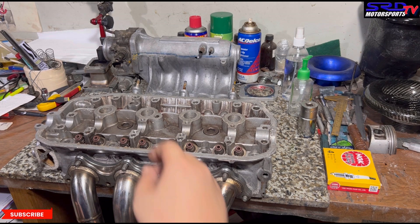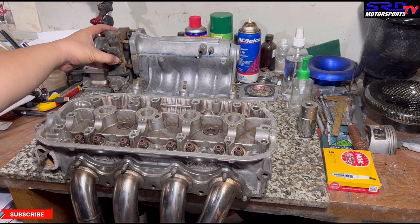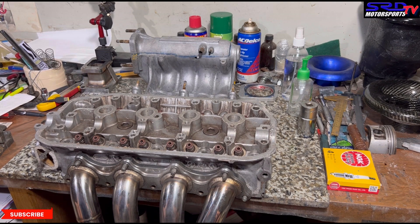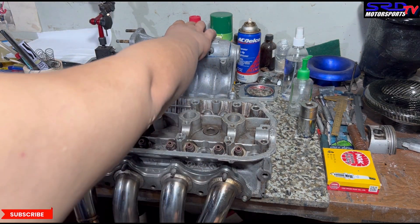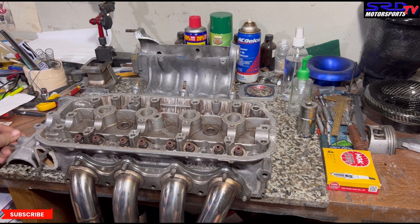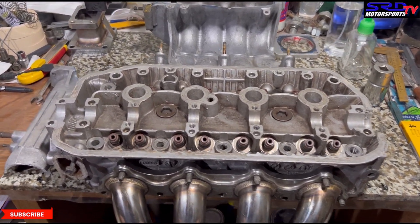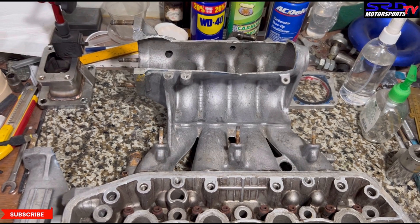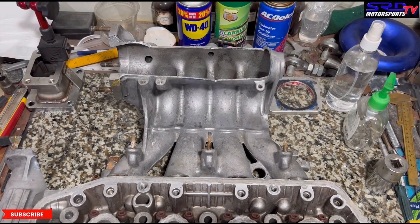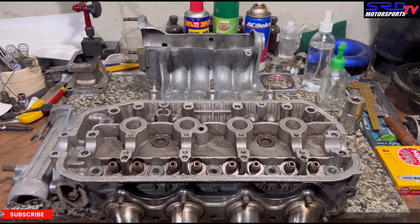Let's get to the nitty-gritty. We removed the throttle mount because the plenum is actually sawn off — we hand-sawed the plenum off. I'm going to remove it just to show you guys the whole image of how the intake pathway goes to the chamber on the head and then into the exhaust. I understand not everyone can visualize it like that, but I like to mock up all the parts because it gives me a good visual and suddenly I get more ideas on how to improve the engine's efficiency and power.